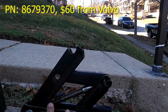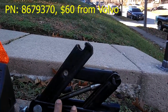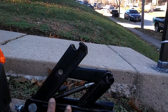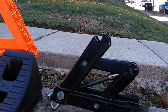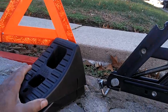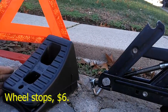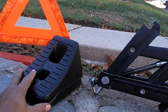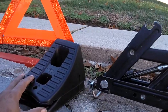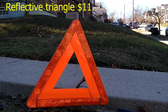You want to start off with the Volvo jack that you often find in the cross-country Volvos from 1999–2000. Don't use the one that comes in the 850 — it's just flat-out dangerous because a lot of these cars have bad parking brakes. Get a couple of wheel stops: put one in front of the front tire and behind the back tire on the opposite side of the car that you're jacking up and changing the wheel on.